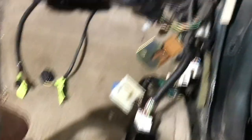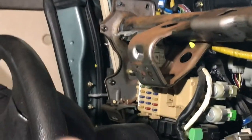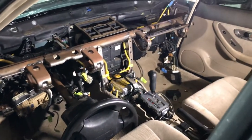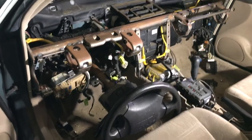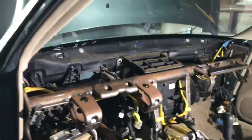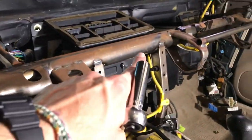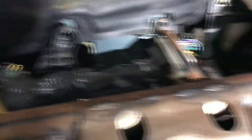Over here on the passenger side, once you get this box with both connectors out, you can access the rest of the bolts for the crash bar. Then you pretty much just go over there and do the same thing — move a few things out of the way to access those. Here's where the dash is at after about three sessions. I got the dash fully out and now I'm pretty much just working on getting this crash bar out. Next time I'll cut these with a sawzall and that should free it up so I can get to the main cluster. Definitely making some good progress.